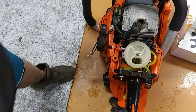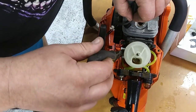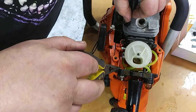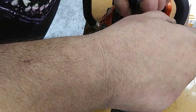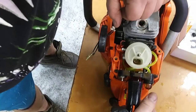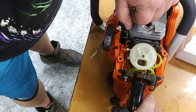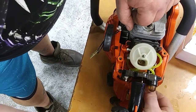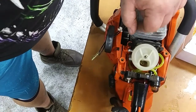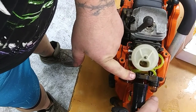Okay, now from a bird's eye view here. Once again, we got the fuel line down here. Goes to the primer bulb. Primer bulb to the tank, and then tank over to here. And then we want to make sure our throttle is in our slot and working, which we have it working fine. The choke, you can see down in here, the choke is working. So everything is in its proper position, everything has room. Just make sure you don't have anything bound up in there.